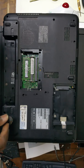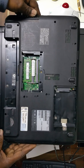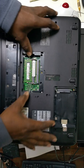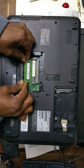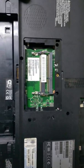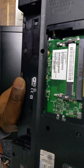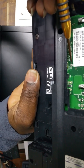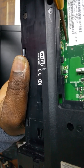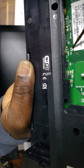Once the hard drive is removed, you're ready to remove the password. On the board itself, to facilitate easier viewing, I'll lift this up so you can see what I'm referring to. On the board you will see three X's — triple X.